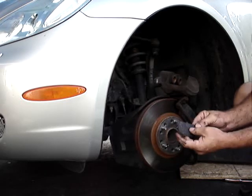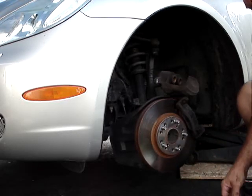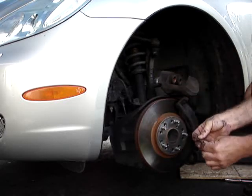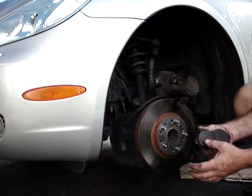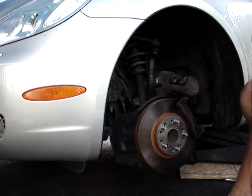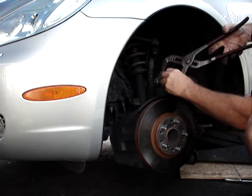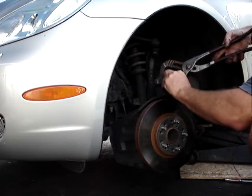The pad holder — they had some squeal stop on them, it was stuck to the caliper. Make sure you look at that and don't double them up if you bought new shims. Got two pad retaining clips. These were aftermarket pads so they don't have the big taper on them. I just use big channel locks with a pad because it's a double piston — that way you can compress both at the same time. You could use a C clamp or a pad spreader.